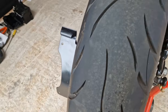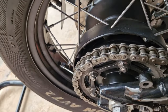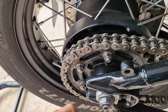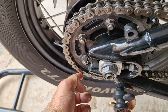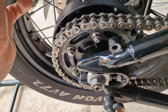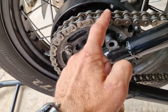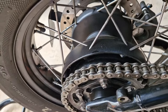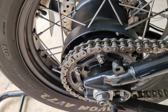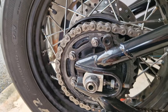Get the rod or spindle, push that through the wheel itself all the way around, then lift the wheel up so you can place the chain on. Get the chain onto a couple of the bottom sprocket spikes and start rotating the wheel forwards - that will basically pick the chain up onto the cog. Once the chain is on, push the remaining spindle through and place the washer and bolt back on.